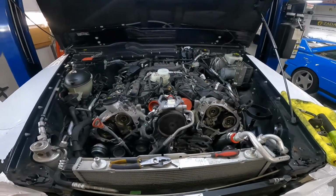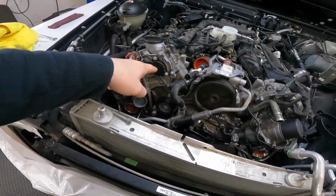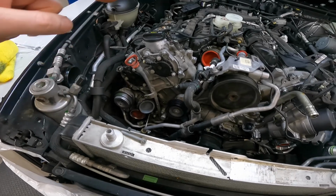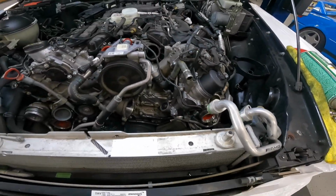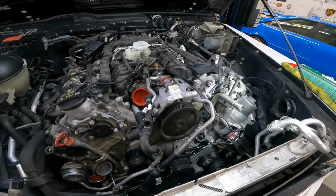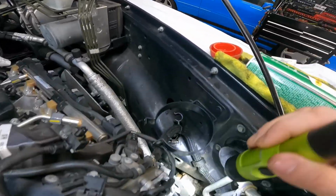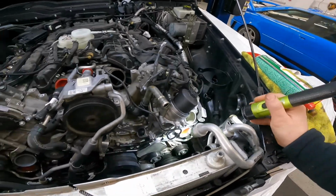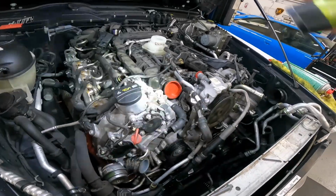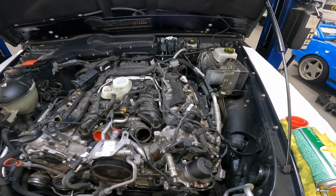Okay, let's start assembling back. Okay guys, valve covers already in, cam magnets, the housing and new line from turbos that was broken already replaced. All that area was washed with brake cleaner and blown dry. Now time to install the thermostat, gasket, and all piping, and possibly try to fire up, but we're still waiting for one part. Here is a power steering hose. It came from another state, probably Monday. But today I want to assemble all that front and replace spark plugs, and of course that brake booster gasket. Oh, sorry, not brake booster, brake vacuum pump.